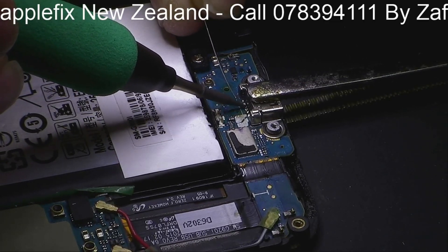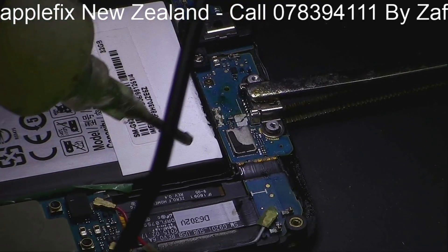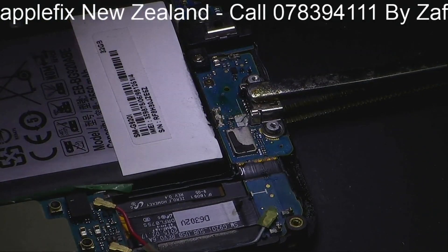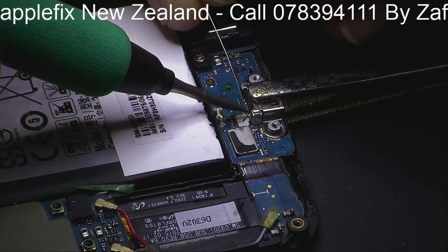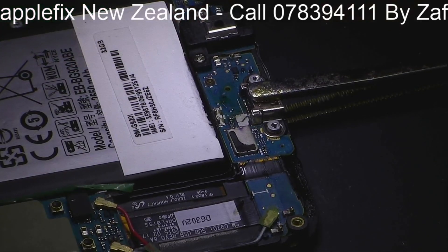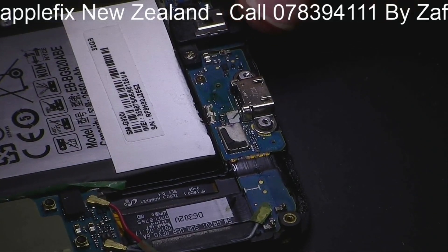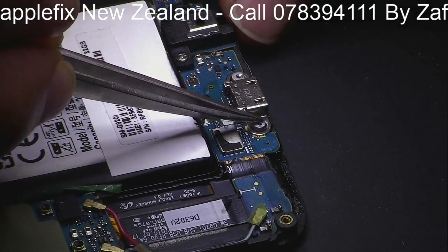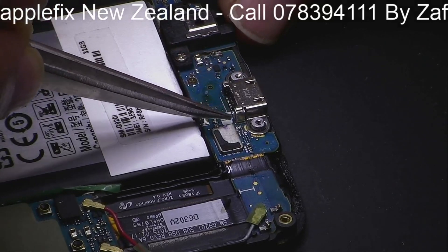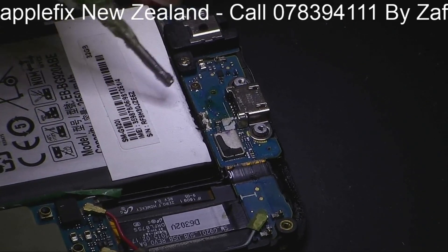This is done, done, done, and done. This is a little bit not melting the way I want it even though it's all soldered - but I think it's fine. The next thing I will be doing is soldering the legs. See these two - the way they made it, they are pretty strong to hold it down. But I will still do a little bit of soldering here and here as well, to make sure we have done the job professionally and nicely.